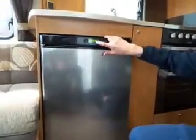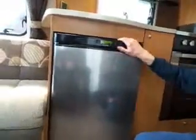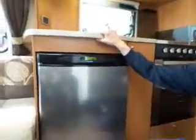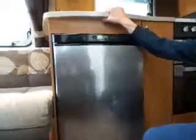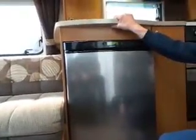This side of it is your temperature range. Five bars lit — that's as cold as your fridge is going to be, so if food is coming out frozen it's too cold. Average is around about three. It all depends on the temperature outside; if it's a really hot day it may struggle and you might need to just up it a bit. You can tell by what's happening in the fridge — open the door and if it's not quite as cold as you expected, adjust accordingly.